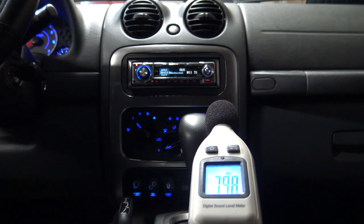I wanted to demonstrate how clean and clear it was — the mid and the bass response — but no matter what I do, whether I record with my wireless microphone, shotgun microphone, or just the built-in camera microphone, when you listen to the video you're only hearing your own headphones or speakers. So when it comes to sound, it's really hard to convey what something sounds like. I took the original head unit and speakers with no sound deadening in the doors, set up a decibel meter in the corner, set the radio EQ flat, and just hit play and turned it up until I got right around the 80 decibel range. Then I did the same thing with all of the new Soundstream equipment.